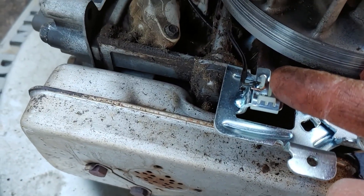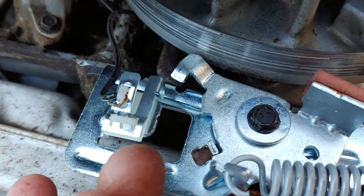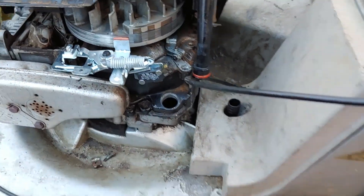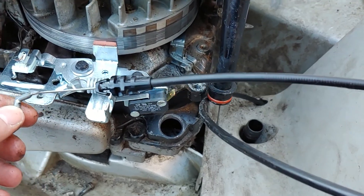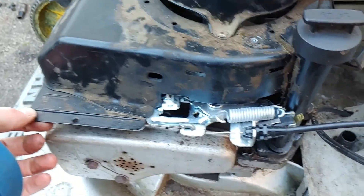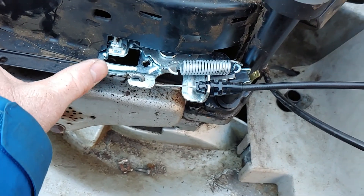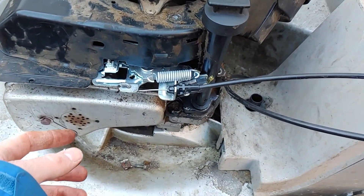The wire is hooked up — there's just a little hole on that plastic part that it goes through. When you engage the engine lever it disconnects, and when you let go it reconnects and it stops the engine. This is another type of switch that some other lawn mowers use. There's a bit of a fitment issue here — as you can see that hole isn't quite lining up. That's because this doesn't fit perfectly; it was probably meant for a newer Briggs & Stratton Quantum engine, but we'll make it work.